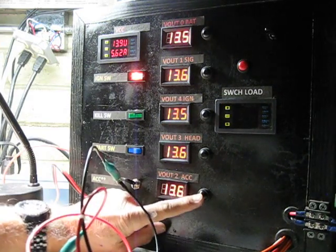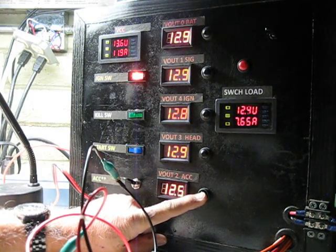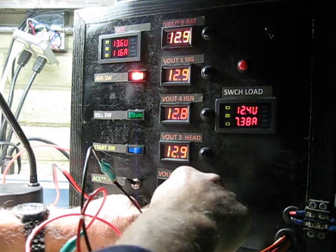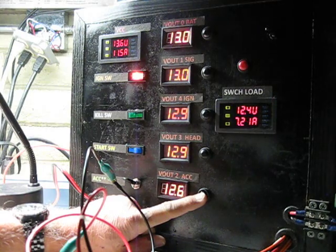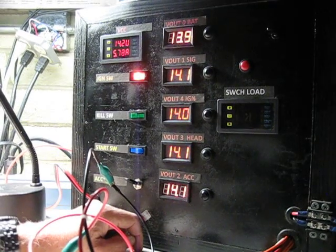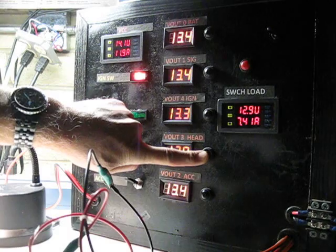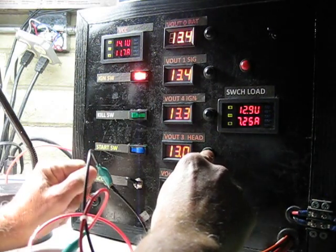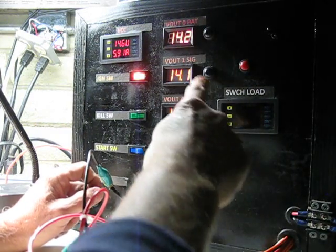Now, again, with my solid-state fuse box production test station here, I can apply larger loads. So what I'm showing here on the accessories, I'm pulling 7.5 amps for that accessory. That means a total of 11.5 amps is coming through the solid-state power box. I can push this up. I'll go ahead and run this all the way up to the max, and I do the same thing on my headlamp. 7.5 amps here we see on the headlamp, a total of about 11.7 amps for the whole thing. So I can go through and do this on each one of them.